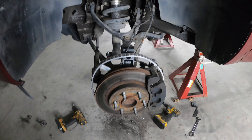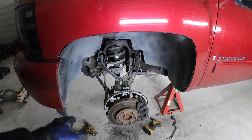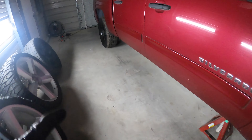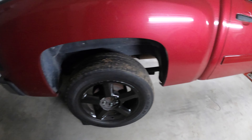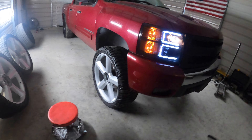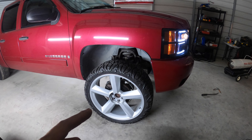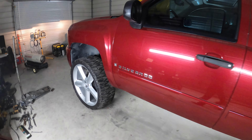Got this side complete. Got the wheel light on here, got everything attached, the new spindle is on, and the leveling kit's on this thing sitting pretty tall. Angles are all good, no worries about that. About to wrap this side up and get started on the other side. The rear wheel lights — these have drum brakes so they're gonna be a lot simpler than doing the discs. Just gotta drill in the right place. Got the headlights installed, taillights installed, got the front done. It's a three inch spindle with a two and a half inch level on the bottom and it's looking real nice.